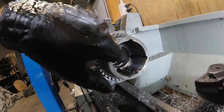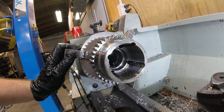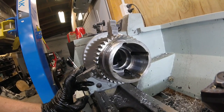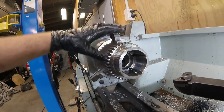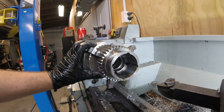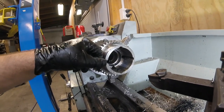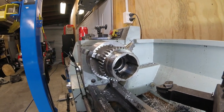What I'm doing right now is chomping out more material from the inside of the gear - you can see taking quite a big bite. There's a second step in there now. It's not a heap of material, probably 500 grams or something, but it's all rotating mass. It doesn't need to be there, it gives me more surface area for cooling, and should make things better. I'll take the diameter out a little bit larger too - there's plenty of meat there, it's not going to break the shaft.